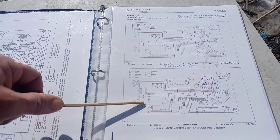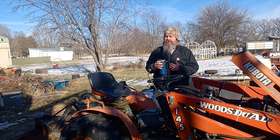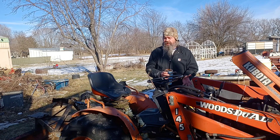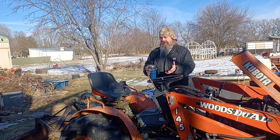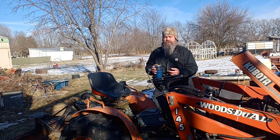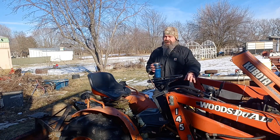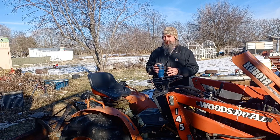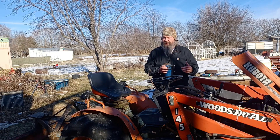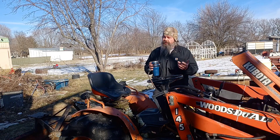I'm going to go order a new switch before we continue. Now I know that my key switch is shorted out. But I also know that if you came to this video because you're having similar issues with your starter, your solution may not be the same as mine — it could be something else down the line. So I went in the back of the key switch and disconnected all the glow plug circuits. Now when I turn the key I'm getting 12 volts to the starting circuit. For the sake of this video, we're going to continue on with the diagnosis just as if the key switch was fine, and we should show full voltage all the way through as we go.